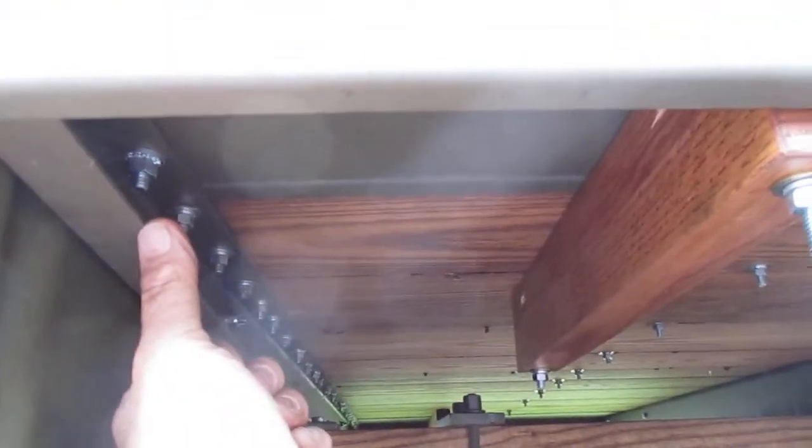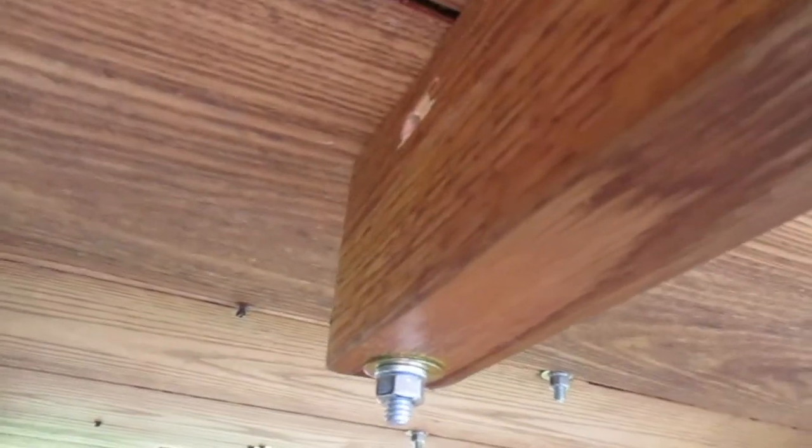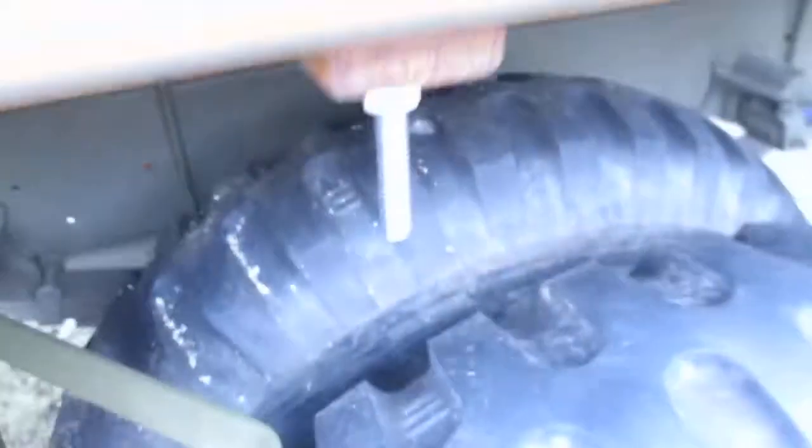Well, that's so we could line this block of wood that I built up. Has to be 8 7/8 inches from the rib here on the front of the tires to here and parallel. So I have that. I drilled up through the floor of the bed, have a carriage bolt there, along with another one here.